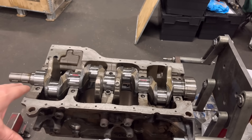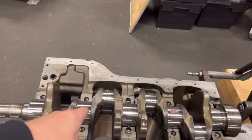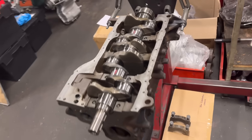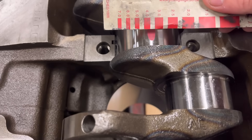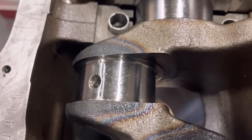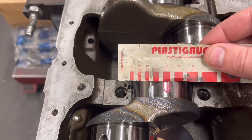Just leaving this crank as it is, I've put it in with a set of standard bearings and just torqued down the two caps here to show you what running clearance we've got. If I get my little gauge here, you can see that — bear in mind this is about a 2.2 inch journal — we are getting what looks like 3 thou running clearance. And here, maybe very, very slightly less — probably 2.8, 2.9 — but it's near enough 3 thou running clearance. Going by the rule of thumb of one thou per inch of journal, if it's a performance engine we tend to run very slightly less — but you're talking 2.2 thou, so 3 thou is way too big on this. It's a thou below bottom limit.